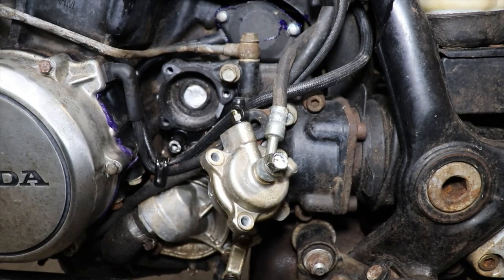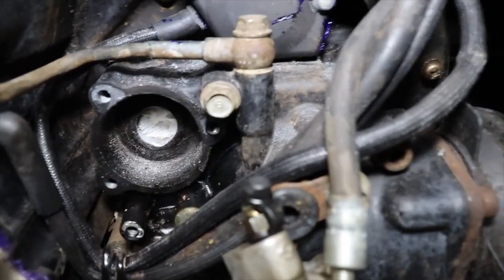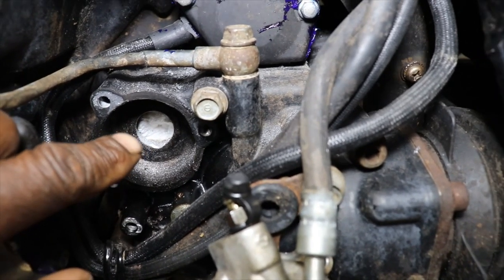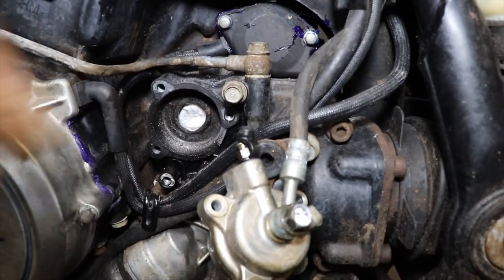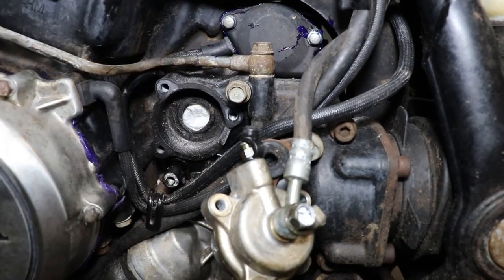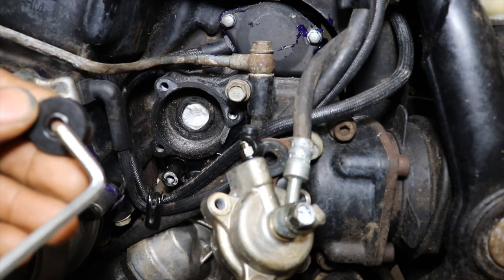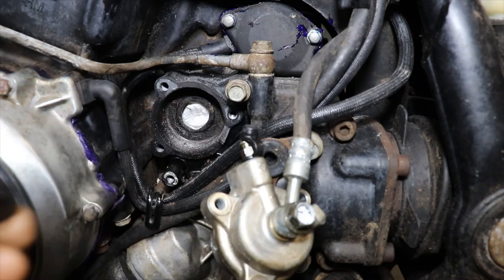So I did some reading online and watched another YouTuber video, and what he did, like I'm starting to do, is you take a Dremel and you make a keyhole, and you can stick the seal in there sideways, so you will go straight in, and then you'll take an Allen wrench, shave it down, stick it through the front, and then pull it through.